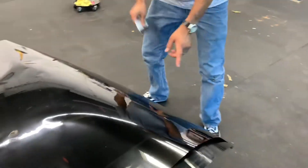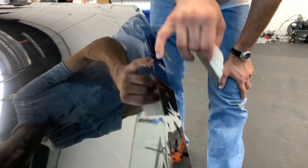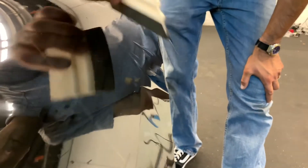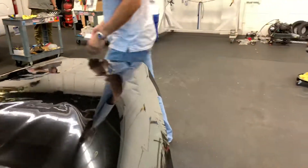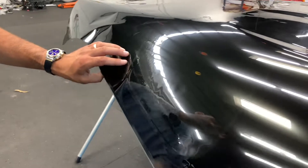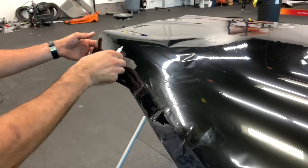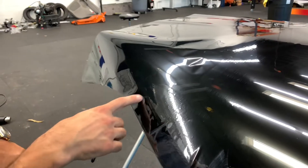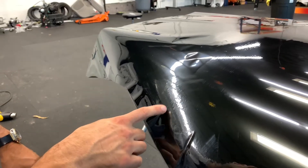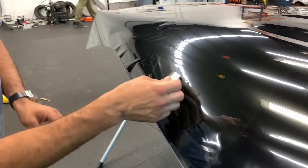This is the end product on this side. You can see the glass aid — I can easily squeegee those fingers past the glass aid without creasing it. I would cut right here; this would be so easy to squeegee down after. But if I brought this around to the side to shrink, it would make it dramatically harder. I'm going to do the same thing on this side — little cheater finger — and then seal it. It's kind of a little pocket right there. If you can squeegee over it without creasing it, it's not enough to worry about.